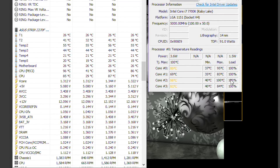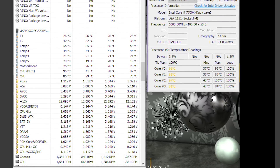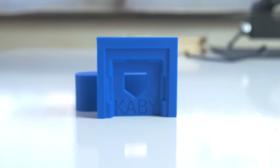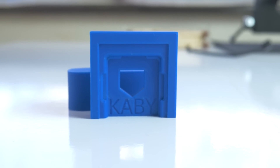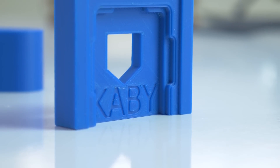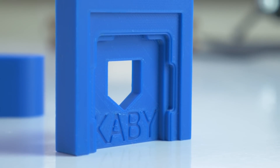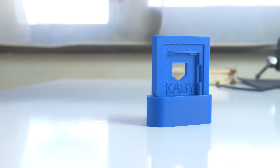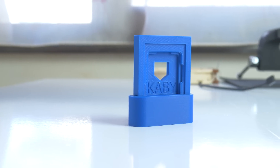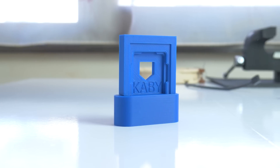Naturally this is not something you can work with, and even for day-to-day tasks it would spike up really fast and make the fans start whirring away. You can delid a CPU with different methods, but I went with a delid tool which I got 3D printed. This is not my design and I do not take credit for it. You can get the designs and print it yourself — check down in the description. I paid 14 bucks to print this, so it's far from a fortune.